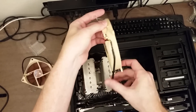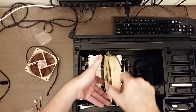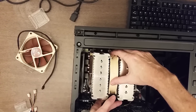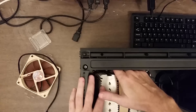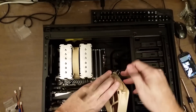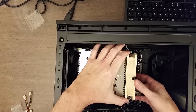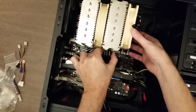This is a 120 millimeter fan whereas this is a 140 millimeter fan. The same rule applies: locate the arrow showing the direction and make sure it's going with the airflow toward the back of the case. The larger fan just goes in until it stops, sitting down at the bottom of the cooler, and you just take the clip over with your finger. Then for the other fan: find the arrows, make sure they go in the right way, and this one will need to be sitting just above the RAM — I'll bump it up very slightly so it's not actually touching the RAM, since contact could produce vibration noise.